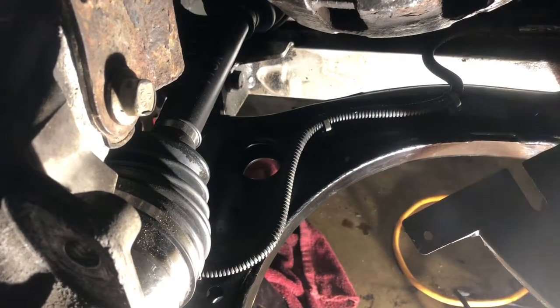Last update before the test drive — we are finished, other than putting the wheels on. Let's run this down: this started as a simple bearing job which turned into a goat rodeo. Due to some frozen fasteners and things not coming apart — axles stuck in bearing hubs and all that — this car ended up with two new lower control arms, two new drive axles, two new inner tie rods, two new sway bar links, and two new bearing hubs, which was the original project.